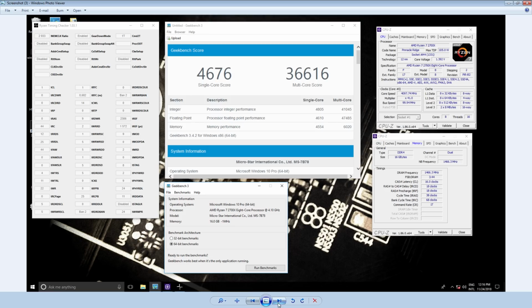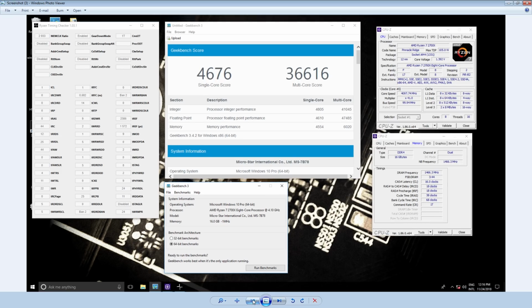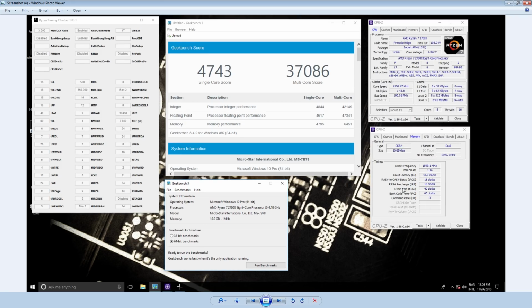And yeah, so let's start doing some actual overclocking on these. And it's bad. So this is 3200 megahertz, 18, 18, 18, 40. Now I could have probably tightened up the timings a bit, but the thing is, we're going to max out the kit pretty soon, and it doesn't get better. So, 6,451 points. We picked up some performance over the XMP profile, as you'd expect. We've picked up some clock speed, but we've not really changed our timings a whole lot. The XMP profile isn't that much different, right? The timings have basically stayed the same.